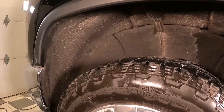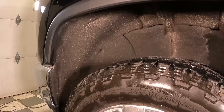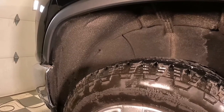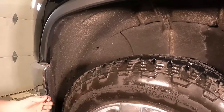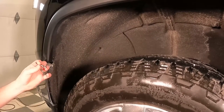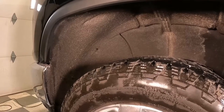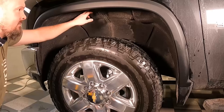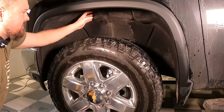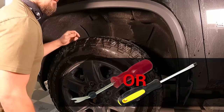We're doing the install on the 2021 L5P Pulsar. We'll take a look at the manual and see the tools required. First thing you want to do is remove the inner fender bolts. There is one push pin right on the top center of the fender. You'll need either a Christmas tree puller or just a flathead screwdriver to pull that out, but the rest are all Torx bits.